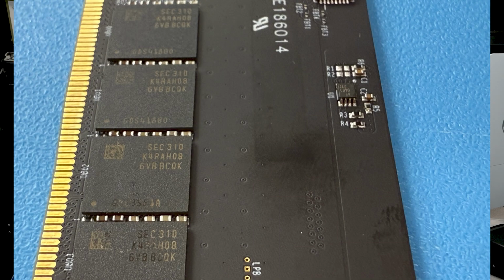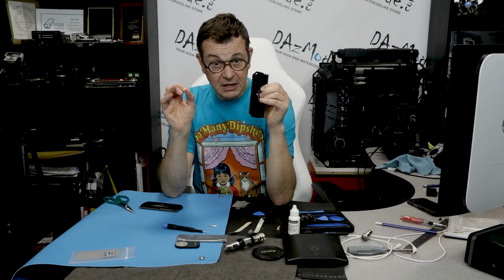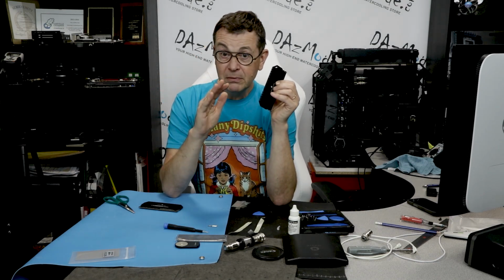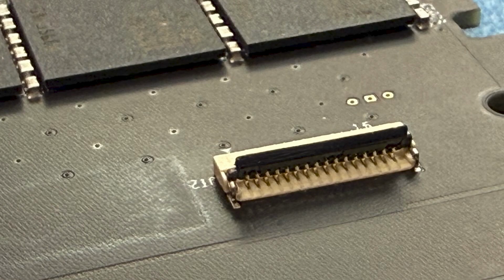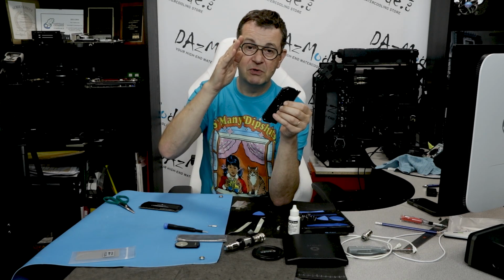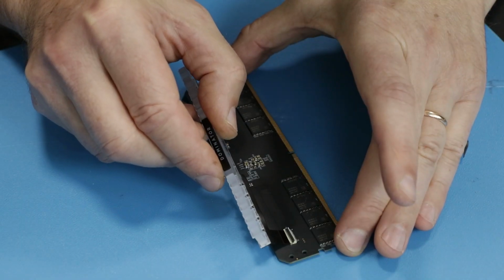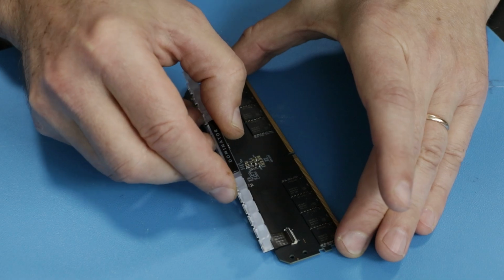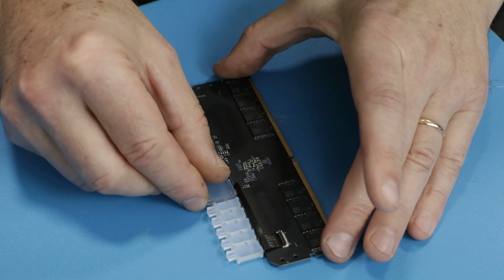Removing the light itself after that is straightforward. You have a ribbon cable, you basically flip a kind of flap and it comes out, very easy. And if you need to install it back, again, you have the flap in the vertical position, slide the cable in, close it, you're done. So theoretically if you need to replace the LED light or something like this, it's a simple thing.